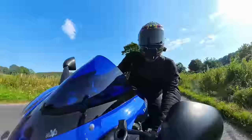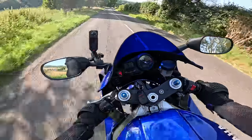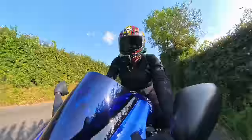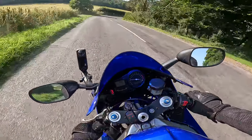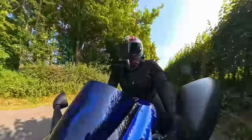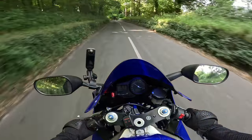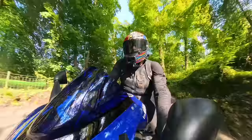I don't know if the tyres are any good — I'm going to take it a little bit steady. I haven't checked the bike out properly yet. The gearbox box feels quite notchy, especially first and second — that could be age-related. In the mid-range there's a little bit of vibration, a little bit buzzy through the footpegs, perhaps. That could be age-related or down to carb balancing, but I think it's probably just a bit of inherent buzziness.